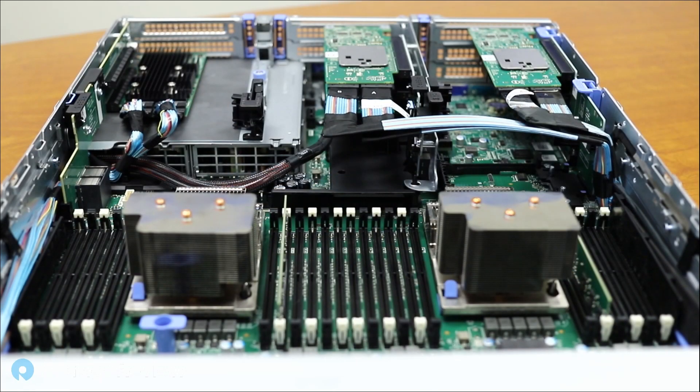Let's take a look at the hardware specifically. The system we have on the desk today is one like the one we reviewed — it doesn't have the DRAM in it, but in the back you can see three cards. Two of them at the top are in the PCIe slots. Dell is taking the approach of using edge cards to break out the PCIe lanes to the front backplane, with three cards serving 12 drives. It's kind of a mishmash — not the most elegant, but probably the most versatile.